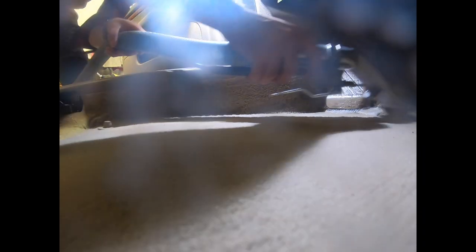I'm blasting every possible spot that I think has stubborn, pernicious ice melt. When you're using that steamer, try to open a door on the other side of the car or you are going to get just a tsunami of steam. Lots of steam happening here. I feel like I've broken up a lot of this with steam now, and the next logical step is to get the extractor going and extract what I just agitated.